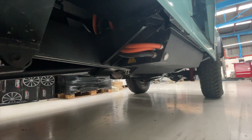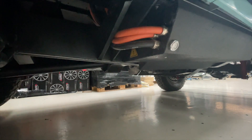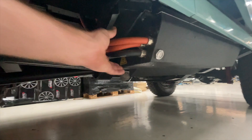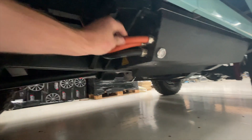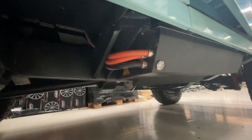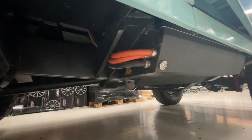The battery packs are under the car — there's a tank pack and packs up in the sides and of course in the front. That's a total of 42 kilowatt hours of battery, which gives close to 200 kilometres of range in a garden-shed-shaped vehicle like this. All the cabling is run inside Flexicon, which has a steel core — the only way to get through it is an angle grinder, making it much stronger than corrugated conduit, which you want on an off-road vehicle.